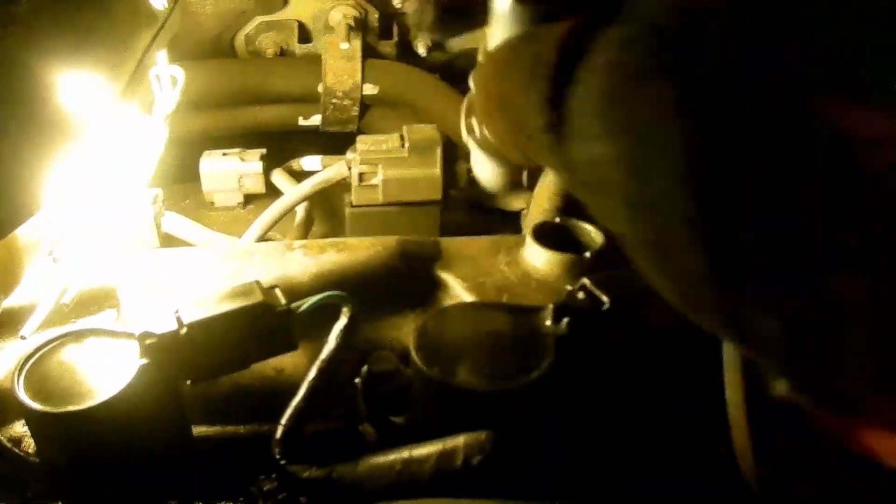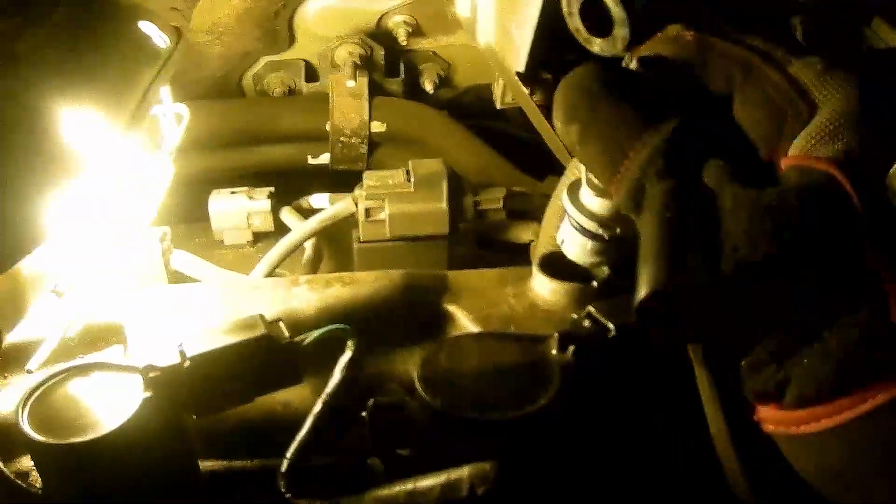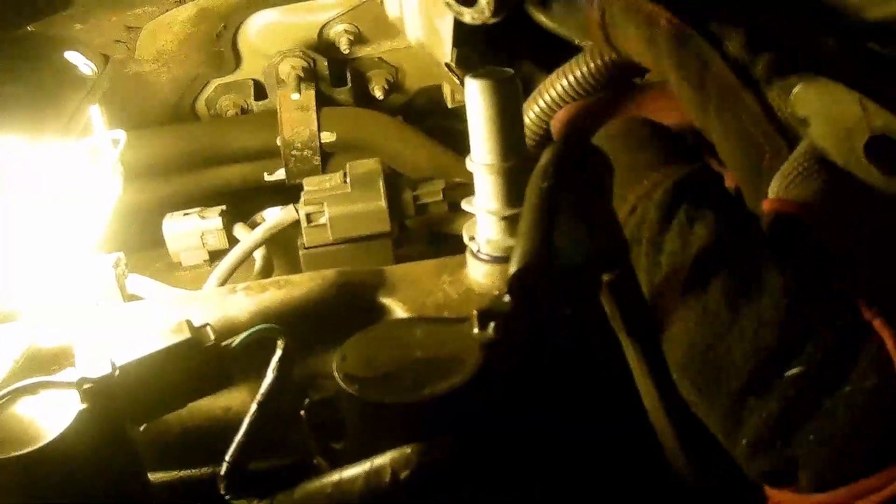I just went and picked up the new PCV valve. They supposedly sell two different types of PCV valve for this specific 3.0L V6, so make sure you get the right one because they are completely different and the other one just will not work for this one. Now I'm going to take it and come back here to where the hole is. I'll stick it in here, and remember, since it spins, you want to make sure you twist it in the right way.